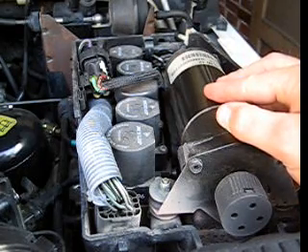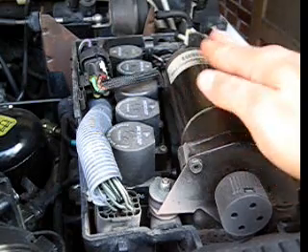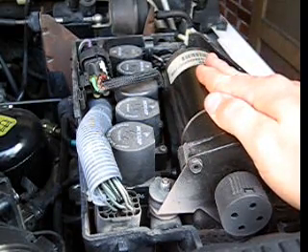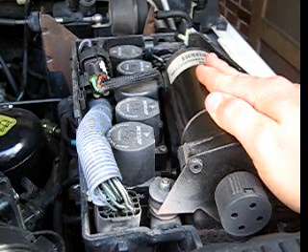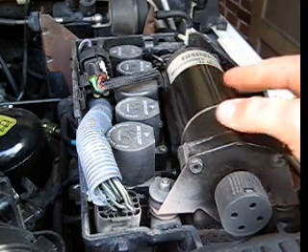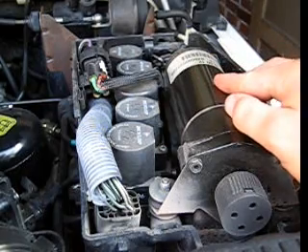In this short video I'm going to show you how to test the over temp sensor and the pressure sensor to make sure they're functioning properly. If either of those two sensors are faulty, the EAS computer will see no reason to run the compressor and it will just simply stay dormant under normal operation.